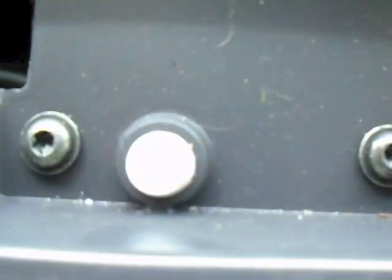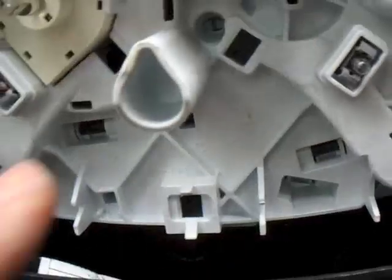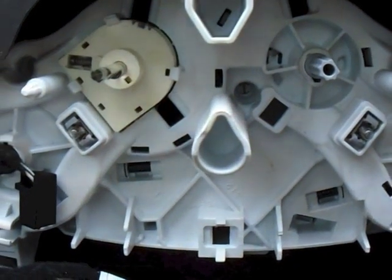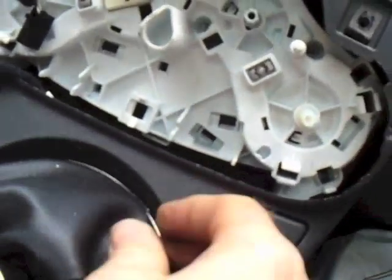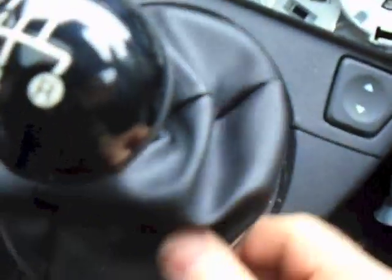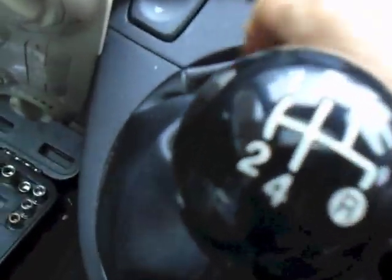If your new dashboard already has the loops on it you obviously don't need to take those out. There's a bolt down there that has to come out, plus two bolts just there with a little locating tab which just pushes out. There are another two bolts down here underneath these switches, and that will just release the heater panel — it just needs to be released from the dash, it doesn't need to come out fully. Now just to get behind here — unclip that, it just pulls out. Be careful with it because it has plastic tabs; you don't want to break it.